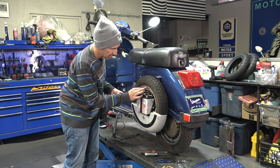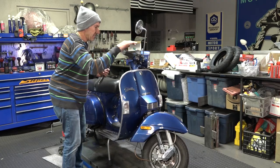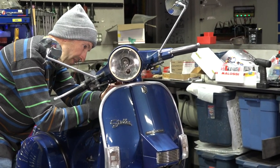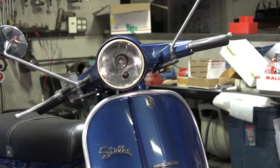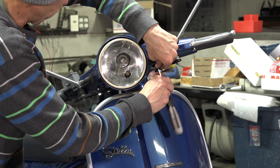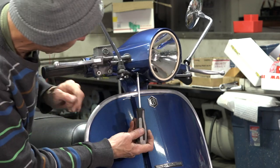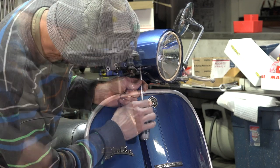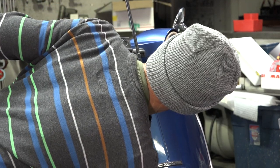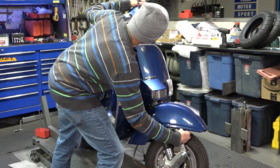Let's see what kind of rat's nest we have underneath the handlebar cover. Just taking out the four screws that hold this plastic handlebar cover off - they're all still here, that's doing good so far. A lot of times they vibrate out or somebody takes this part and doesn't bother putting them back in. Some other things I'll do: I'll get rid of these rubber bits on the mirrors and cut them right off, and more importantly there's a little boot that covers the wiring for the front brake switch - we'll go ahead and replace that.